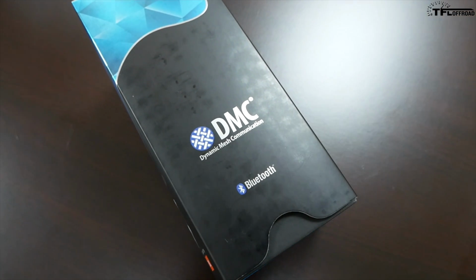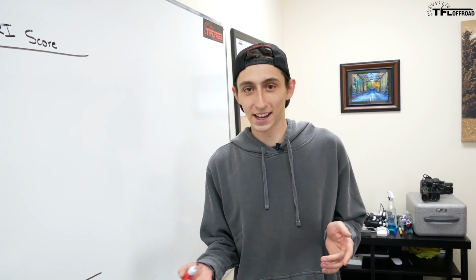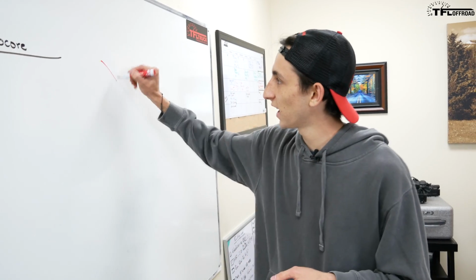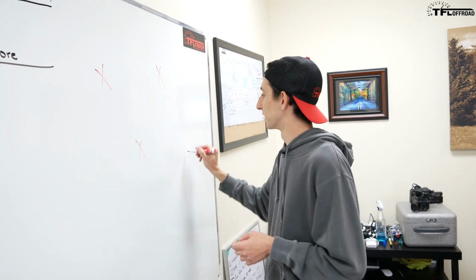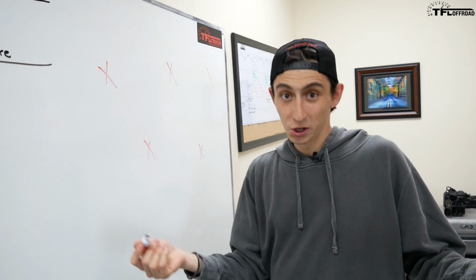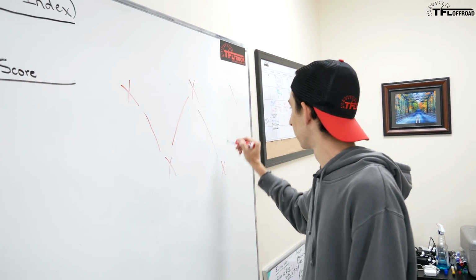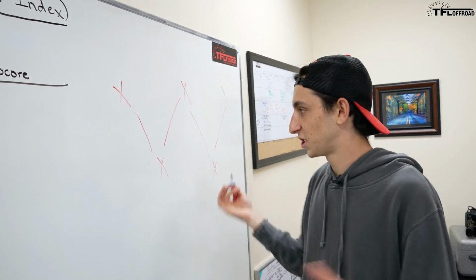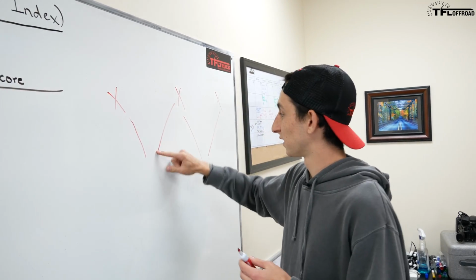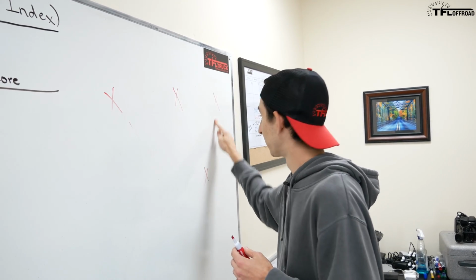Alright, so I mentioned earlier DMC, which stands for Dynamic Mesh Communication. Before we had this technology, everything worked off of standard one-to-one Bluetooth connections. So let's say we had 5 riders going staggered down the road together. Regular Bluetooth communicators, even the new ones made by Cardo that aren't top of the line, basically make a single link between all the riders, daisy chaining everyone together. If you lose one rider, then everyone's link cuts out. The entire group needs to pull over and reset their communicators.